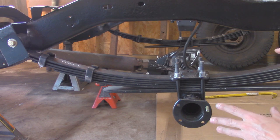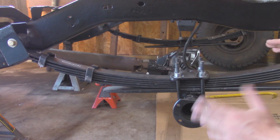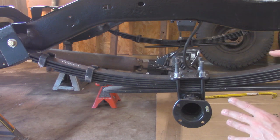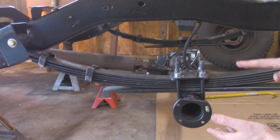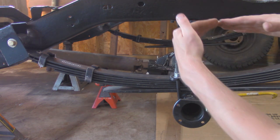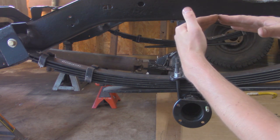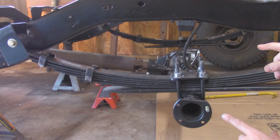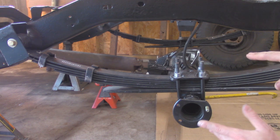So after I install this axle over here, I was taking a look at the drive shaft and how everything aligned and debating on what I should do. I ended up actually removing that leaf spring shim entirely because the pinion was pointing too far up in the air and creating an angle to the drive shaft, like a mountain peak, when it's supposed to be a little bit below, kind of like a divot, to match the angle coming out of the transfer case, except opposite.